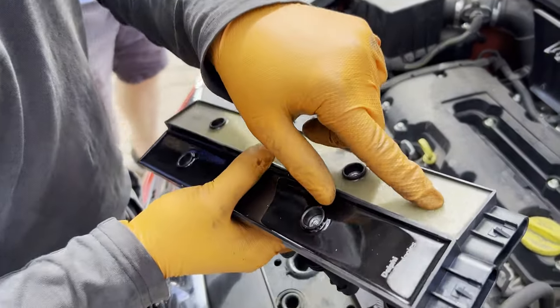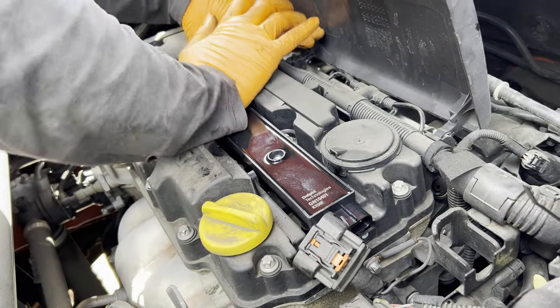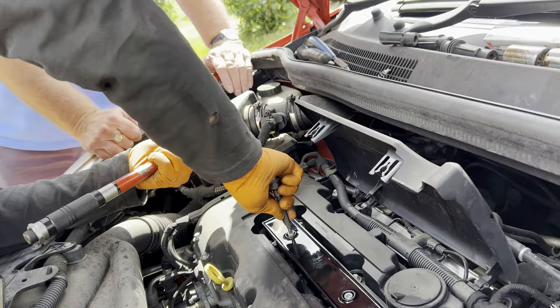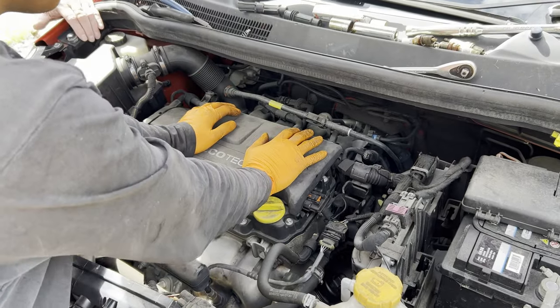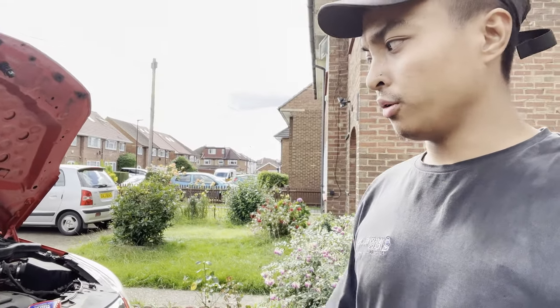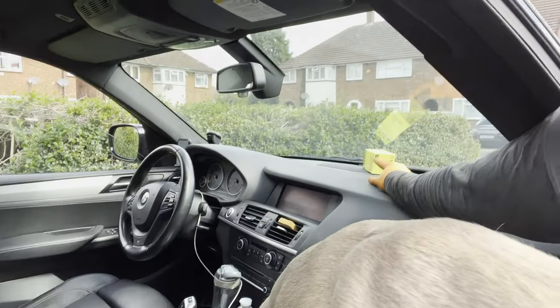Delphi for Delphi — that's how it should be, OEM for OEM. Installing that now. Good contact. New plugs, new coils — lovely. We've just done the oil, put the Triple QX in there for the time being with a new oil filter. After that we'll wait a few minutes, put an engine flush in, drain it out, then put the good oil and Mann filter in.